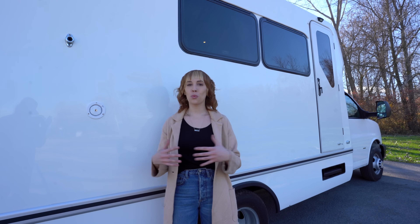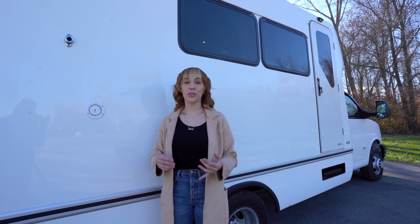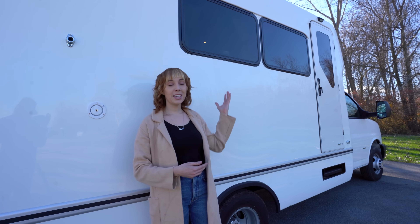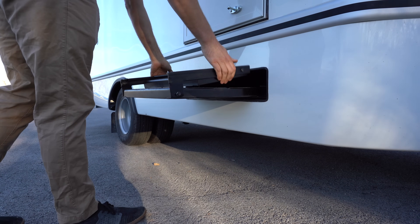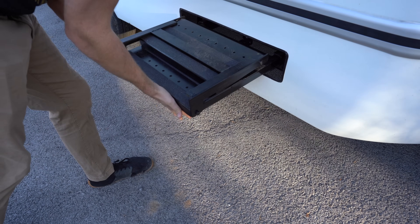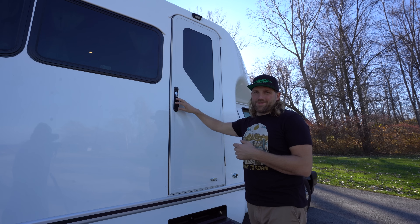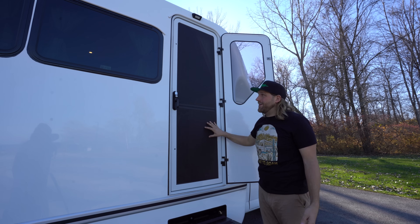When Drew and I purchased this vehicle, it was just a regular box van — there were no doors or windows on the side of the box. In order to do the type of build we wanted, which included solar on the roof and cabinets mounted to the inside, we knew we would have to reinforce the framing of the box. We did this with all new 1x2 steel tubing, which gave us the opportunity to frame out each door and window and strategically choose each one's location. Next up is our custom-built stowaway staircase — these do not support on the ground, which allows easy access in and out of the vehicle anywhere you are. Above the stairs, we have the incredible Arctic Tern Wildlands door, which is an entry door as well as a security screen.